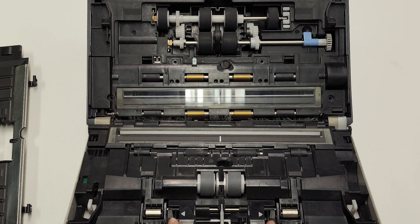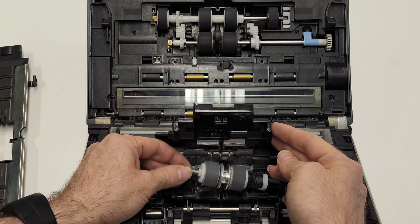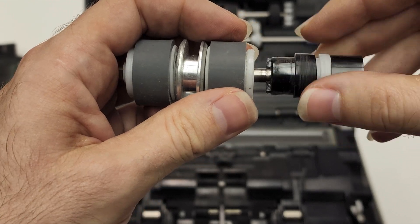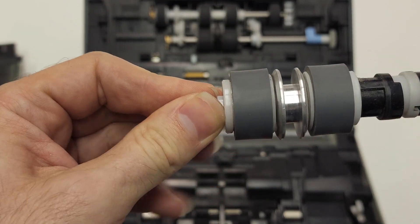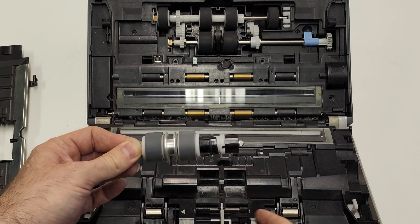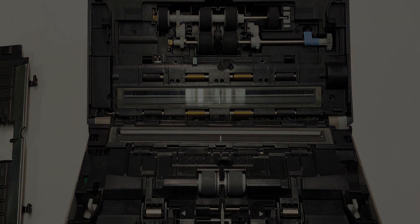Please also ensure that the belt in the center of the roller assembly is parallel with the direction of travel of the paper. To replace the reverse roller, squeeze the two tabs on either side of the paper press, indicated by white arrows, towards each other and allow the roller cover to flip open downward. Pull the roller and torque limiter assembly out from the left tab, angled slightly, and then remove towards the left. When replacing the assembly, ensure that the new reverse roller has engaged with the small black tabs on the torque limiter, indicated here. Squeeze the two parts together slightly while locating the beveled end of the reverse roller assembly in the plastic holder. If the reverse roller has not engaged with the small black tabs, the roller will rotate freely and cause multi-feeds.